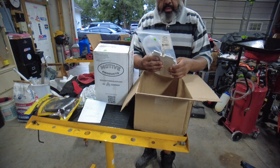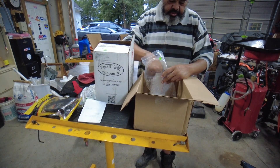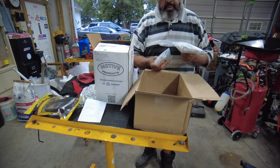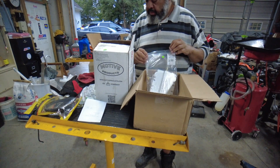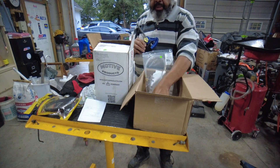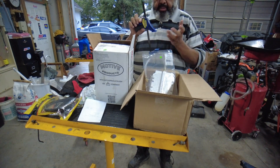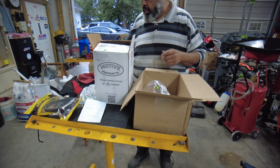So let's see what's in the box. This is the adapter plate that goes on top of the master cylinder. Included are some J-hooks. What they want you to do is put this on top of the master cylinder, find the one that fits your scenario, chain underneath, J-hook through the slots with a butterfly nut. After doing some product research, a lot of people were complaining about the J-hooks not sealing properly, so they went to the local hardware store and got some clamps instead — clamping the bottom and top of the master cylinder and tightening it down.